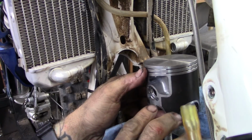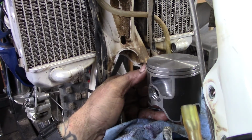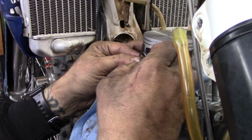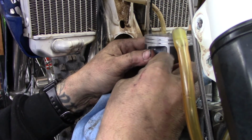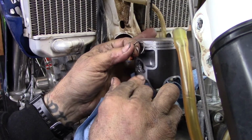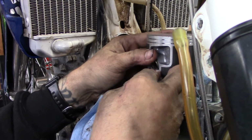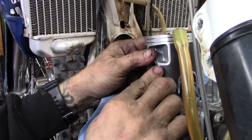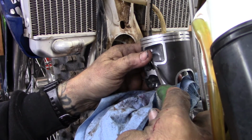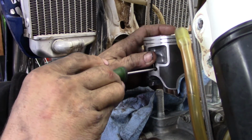Now, like I said, this side's actually easier once it's on here because the pin is held tight against this other side, against this other clip. So you're going to come in, going to have the clip like that down, and we're going to come in like that, and it's home. Again, I want this into the clip in that hole. So line that up like that. Thumb tight on top of that. Nice thick pick so it doesn't bend. Come in here to the hole, and we're going to walk it on.